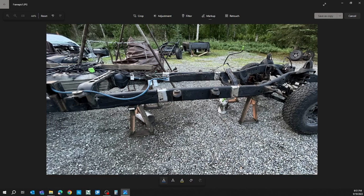Okay, so for me, what I did is I took my measurements before I separated the rear section of the mega cab, of the body mounts, distances between those two. So I know what they would be the same and what I had to measure into when I put the new section on. I also center punched on the frame itself, right up here in the center of the frame at these mounts, so I could also take measurements, just cross squaring in different spots, here to there, and of course took my measurements from here to there and so on.